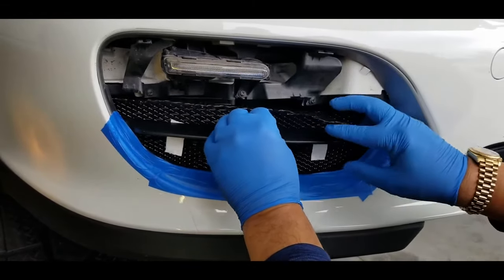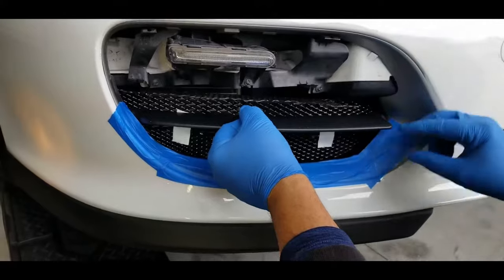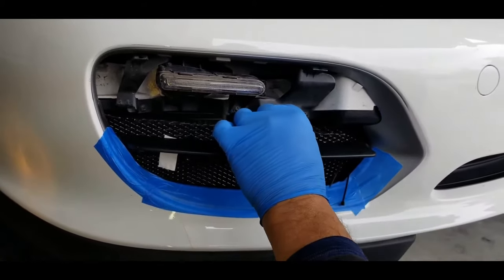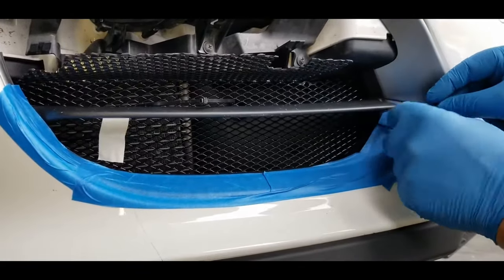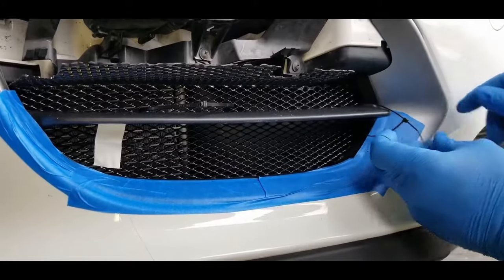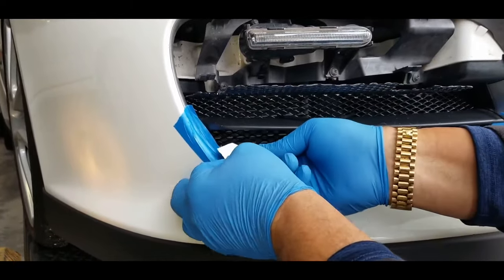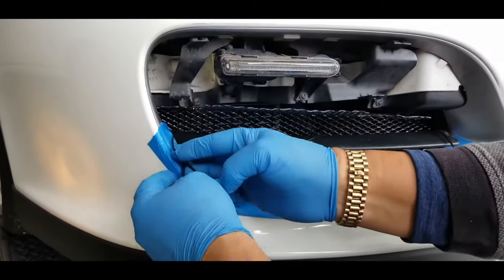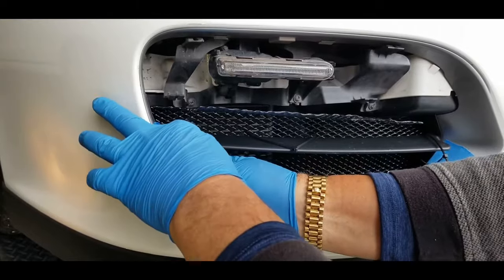Grab the leash and slide it over. You can see how this cutout here matches up with the tab and tab there. Now, what we're going to do is undo our other piece of tape here and release that zip tie. Zip tie over this front crossbar — it's going to go in this little groove here and then engage it, but don't snug it down yet, just until it starts clicking. You'll want to pre-fit the grill to confirm the placement of these zip ties. There's just enough variability in the manufacturing process that you might want to move them over one or two slots.